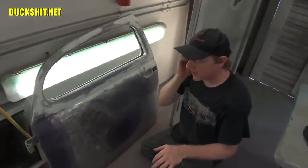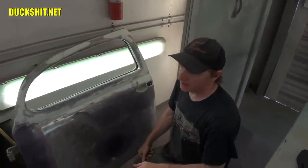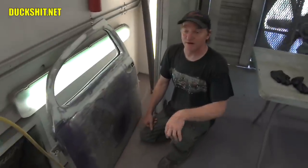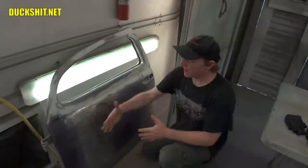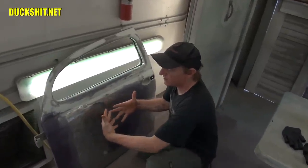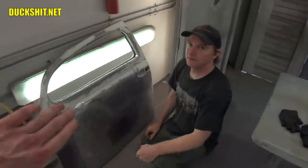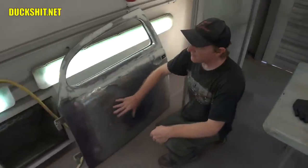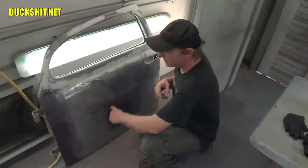So the guys back in the days of doing bodywork, where they didn't have the privilege of having this stuff, they really were better than what we are today. Now tell us what the oil canning effect is for those that are watching. The stretching of the metal of a flat panel, if you had a dent in it, you stretch that metal in there, and when you beat it back, it flimsies the panel. So let's say if you're waxing it, what might happen? If you have, like, this has nothing reinforcing the back. There's no beam in the door or nothing.